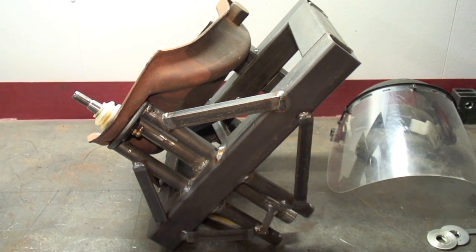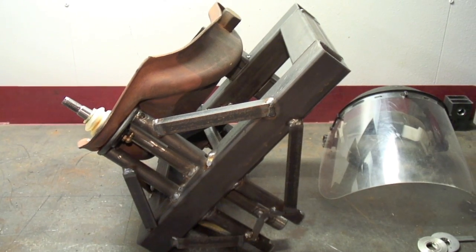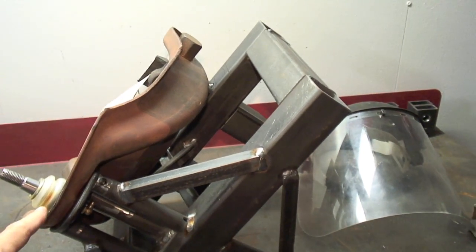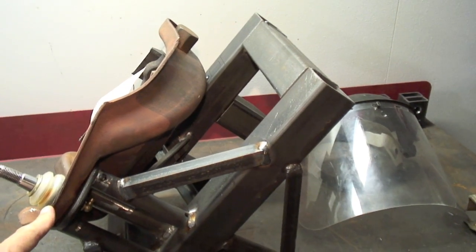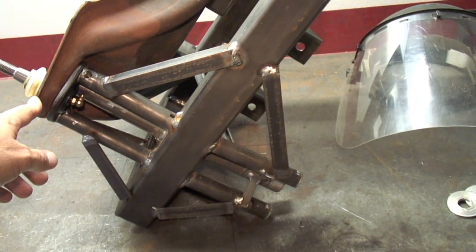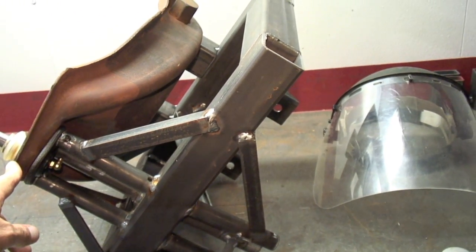This week's Resto tip is jig building. In this particular jig we're building, we have a 64 Galaxy. We have the control arm and we built the jig for it so that we can build the new control arms tubular for lighter weight and also the wow factor for better looks.